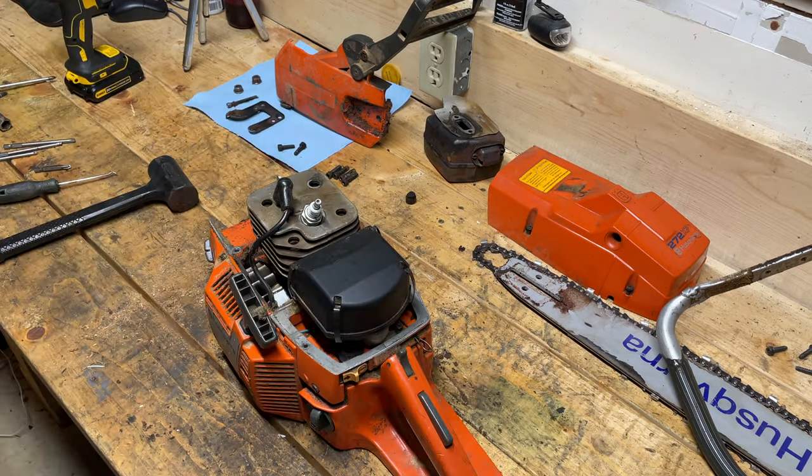Let's check out the piston now. Maybe not as lucky — in my opinion, this piston is a goner. No damage on the intake side at all, and the ring still moves a little bit on that side, but this side is concerning. For giggles, I might try and save this — get some sandpaper out and see if I can get the ring free without breaking it. But it looks pretty pinched and damaged. I'm thinking the smart bet is just to buy a Meteor piston and ring, clean up that cylinder, and slap it back together.